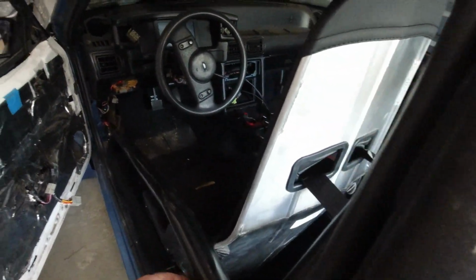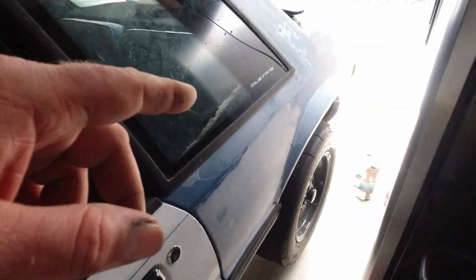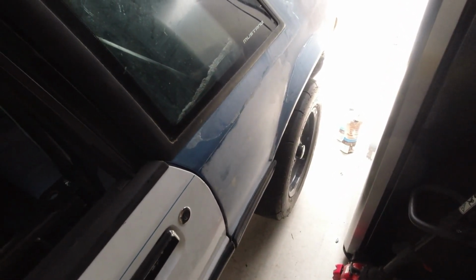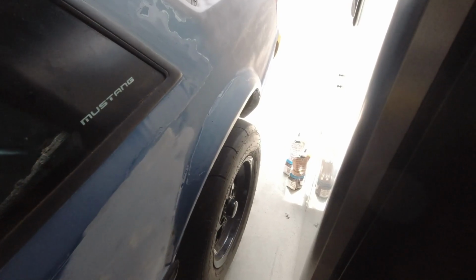Want to get the rear finished up all the way. Got some gear oil I'm gonna put in it. Put some Valvoline synthetic. Don't need friction modifier. It doesn't have clutches in it on the locker, so won't need that. I'm just gonna pour the two things of oil in. Probably won't take both of them, but we got two there. Should make it a lot easier. Just flex top bottles, or bags we want to call them. So should make it really easy to put oil in it. And we'll get that sealed off.